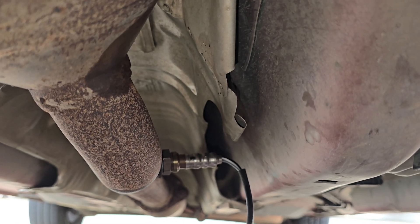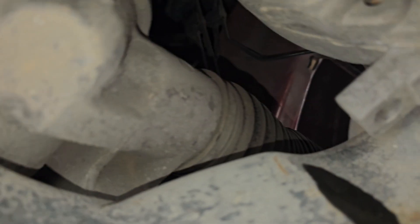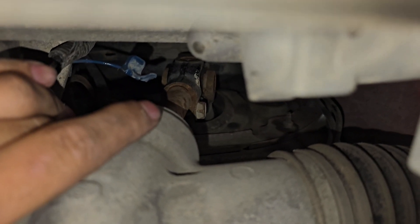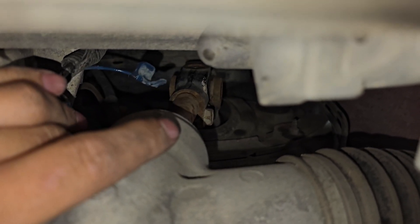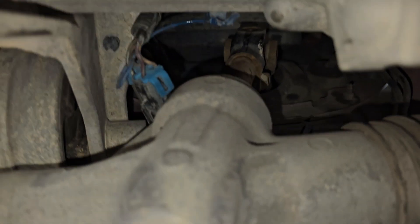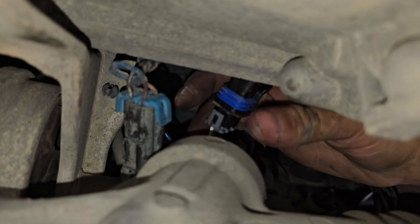Now when installing the connection for the O2 sensor, we're going to snake it up over the top of your stabilizer bar here, up through here. Remember there's our tie rod connection, so we're snaking it up through here. Right here is your steering column and your power steering is right here. You're going to want to have the connection to the left of that — you don't want it circling around the steering column or it will eventually wear into your wires, and that's the last thing you want. So to the left of your steering column connection, snake it up here. I have it on the wrong side — it needs to be on the left side. Snick your hand up through here to grab it, just like so, and now that it's up here we can connect the two.